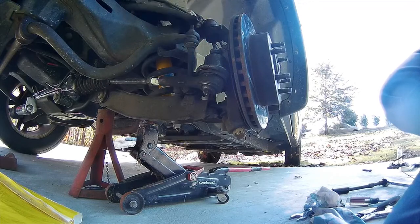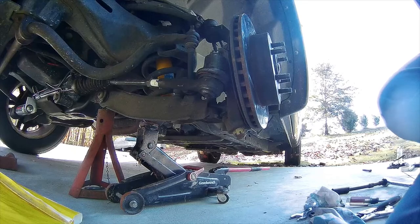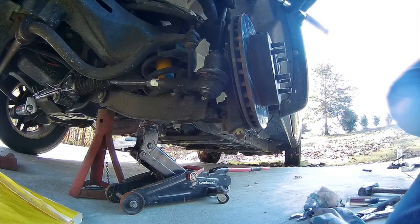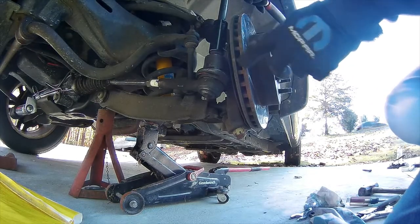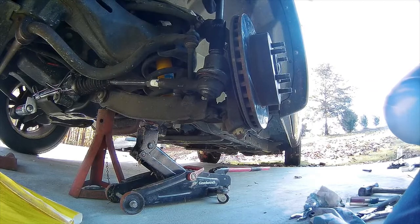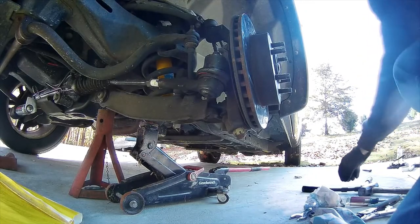She's tight. Got lucky — or I'm just smarter than I think I am. Normally I would heat this knuckle up — it expands — and how I was tapping it, it usually will drop right out. This one has been off recently and I'm assuming that's why it dropped out so easy. That's a win-win for me.